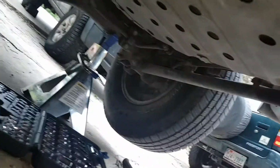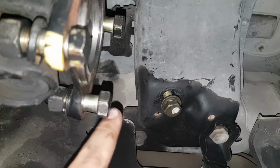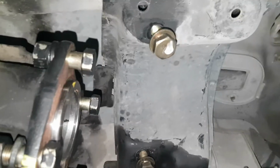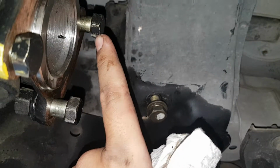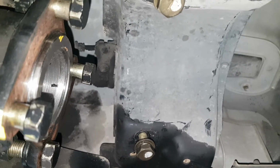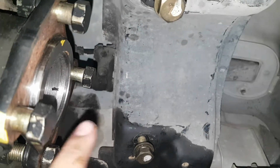What you need to do is raise the back tires and support them. After you get them supported, go ahead and break the first 3 bolts that you can reach. Then go inside, take off the parking brake, stick the key in the ignition, put it into neutral, and then spin the drive shaft until you can access the top bolt there. They're both 17 mil. You're probably going to have to do the open box trick, where you connect them together to get some extra leverage.